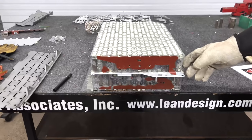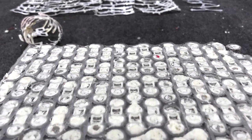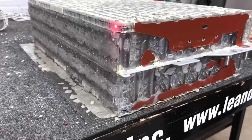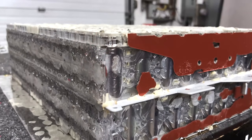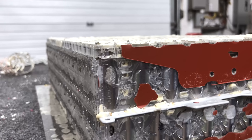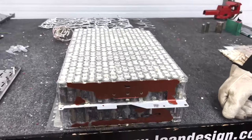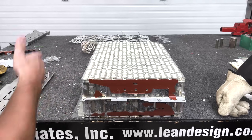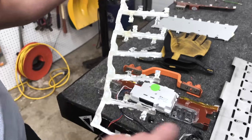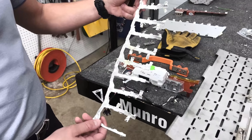Before we move on to the current collector, let's talk about the structural polycarbonate around us. There is a hold-in-place layer on top where all the cells fit into. If you get a good side view, you can see about how far down the cell it actually goes — about 15 to 20 millimeters of overlap where that substrate sort of gloves around the top of those cells, just like an egg carton, keeping those in position until all the side panels are snapped together. Moreover, that polycarbonate is keeping all these cell arrays and bricks in position while the current collectors are brought over the top and all these little tabs — which go directly to the tops or end plates on those cells — get welded. So that polycarbonate substrate is really keeping everything in position while these other processes take place.